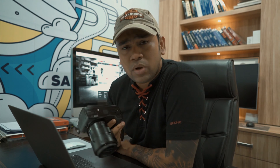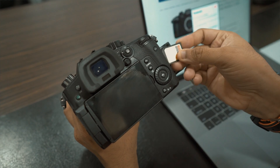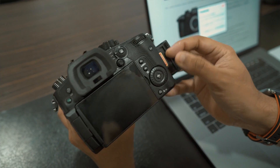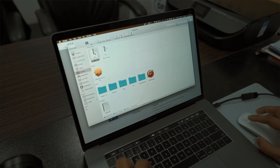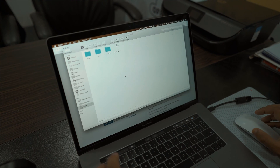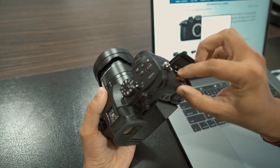It's easy — just grab an SD card, insert it into your GH5, go to the fourth setup menu, format the card. Take the card out of your camera, connect to your computer, and unzip the firmware file you downloaded from the Panasonic website. You'll get a .bin file — just copy that bin file to your SD card.